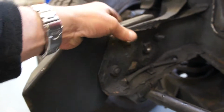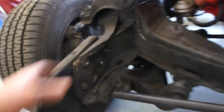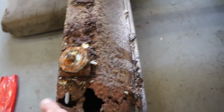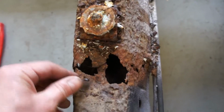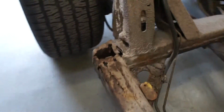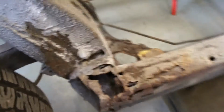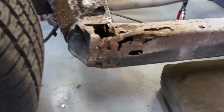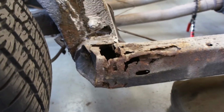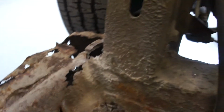This is the passenger side now, and that's all blown apart in there and blown apart here. And then moving down on the right hand side, same thing. The chassis has absolutely broken its back there. That mount as well has just pulled off. The two rear body mounts pulled off as well. The minute you put a socket on the head of the bolt, they just pulled out of the frame rail and out of the body. Same round this kick up, same all in here. There's just nothing left of it.